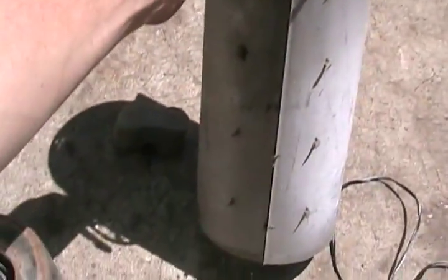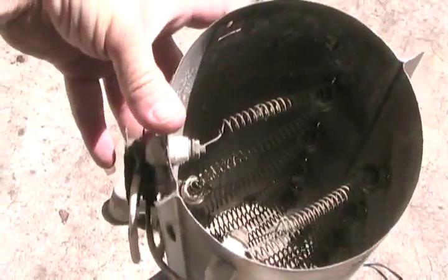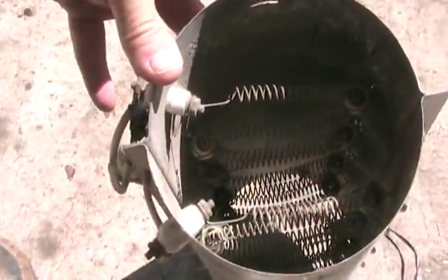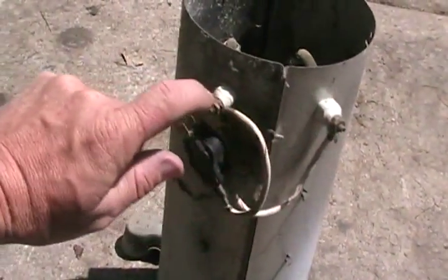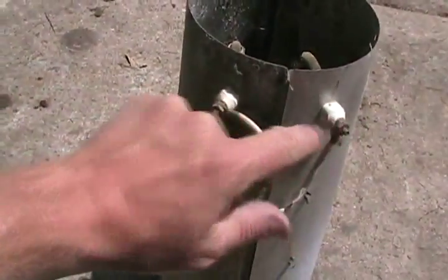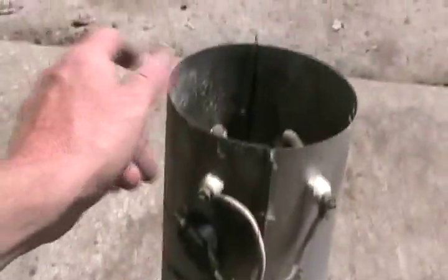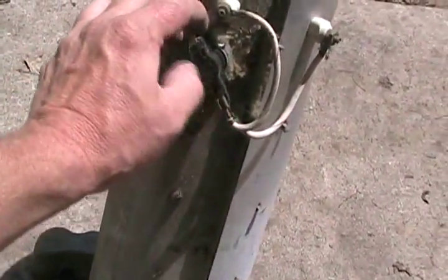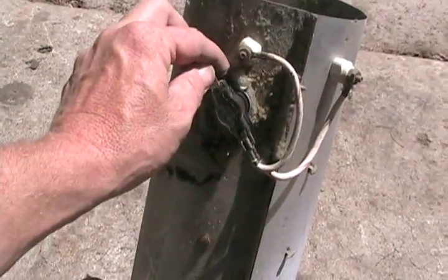Every dryer has a heating element. They're just a nickel alloy that makes high resistance when it gets hot on that coil. When they burn out, you sometimes can't see where they're burned out, so you put your meter on it and test — you should get fairly low ohms, anywhere between 10 ohms to 30 ohms. You can also test continuity between your thermal cutouts. Across there and across there should be a very low ohm reading, meaning power can come through.